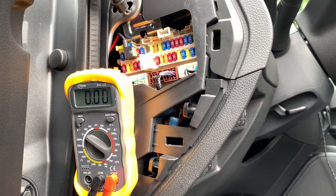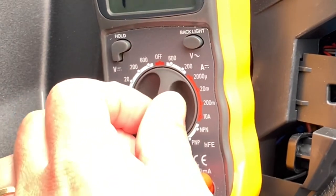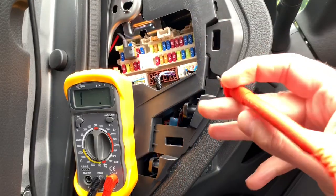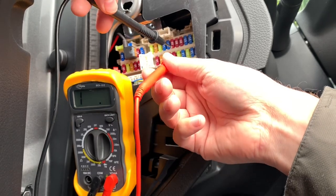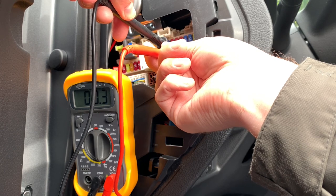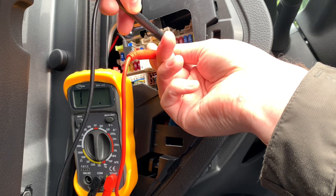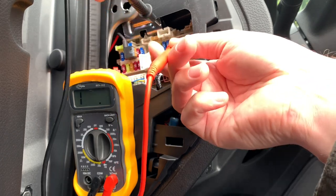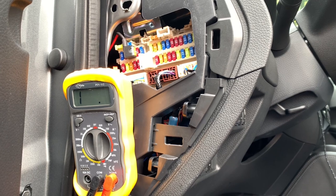In order to check if the fuse is still working, I turn the multimeter to the ohm setting — I'll take the lowest ohm. The thing now is to put both pins into the fuse holes and you will have your reading. You can see my reading, so that fuse works. There's another one just beside it — and there you go. This way you can test every fuse to see if it still works without having to remove them.